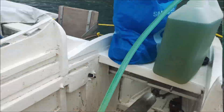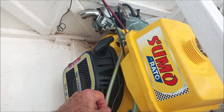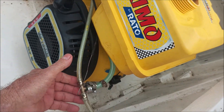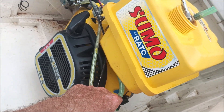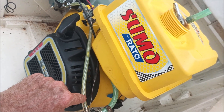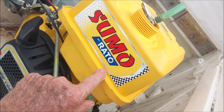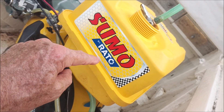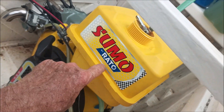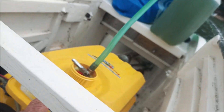We put some gas into the tank here because we want to test for gasoline leaks. This hose here is too big — I think I got five-sixteenths when I should have got a quarter. This is three-sixteenths or one-eighth, so it fits on too loosely. This one is one-quarter inch and that's one-eighth inch, so it's half the size. They mismatched the tank drain with the carburetor.